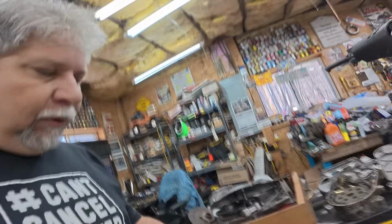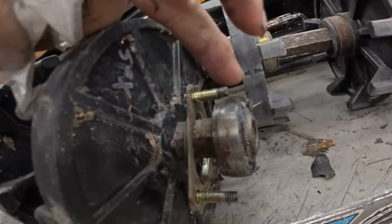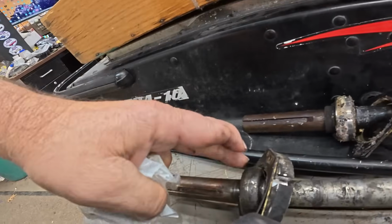All right, dug around in my stash. Found some bearings that I had bought a while ago. 351-4525, I believe, is the number. They're kind of smeared off the bag, but you can go to the online Polaris parts catalog and confirm. I don't know. Do you guys know? Leave a comment if you know where to get these aftermarket. These spherical bearings that press onto the jack shaft and the drive shaft. I don't know. Anyways, I'm going to swap them out quick.